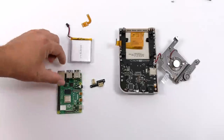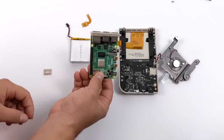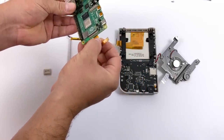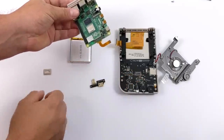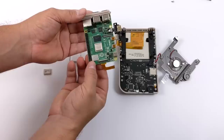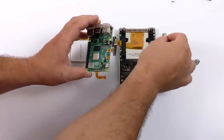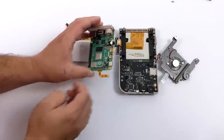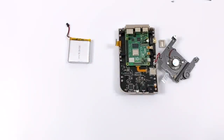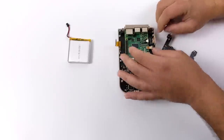Now it's time to install the Raspberry Pi 4 inside the case. I'll install the faceplate for the Ethernet and USBs, then grab the SD card adapter — a little extension ribbon cable that goes to the main PCB in the Pi Boy DMG — and plug it right into the SD card slot on the Pi. If you opted for the HDMI adapter, go ahead and plug that in now also. We've got the Pi 4 set up. Don't forget to add the HDMI adapter faceplate. There are four little lineup pegs that fit into the Raspberry Pi 4 mounting holes, and it lines up really nicely inside the case. Double-check that the Raspberry Pi is fully seated.